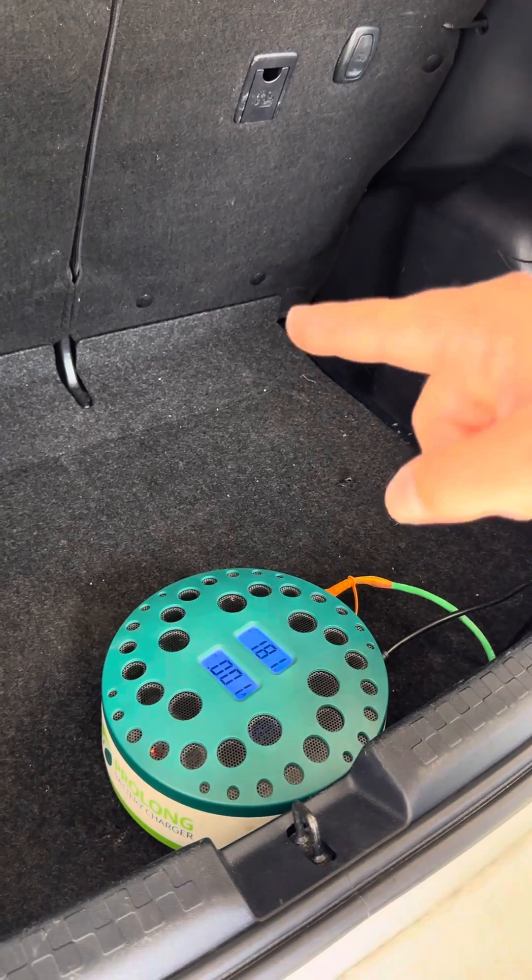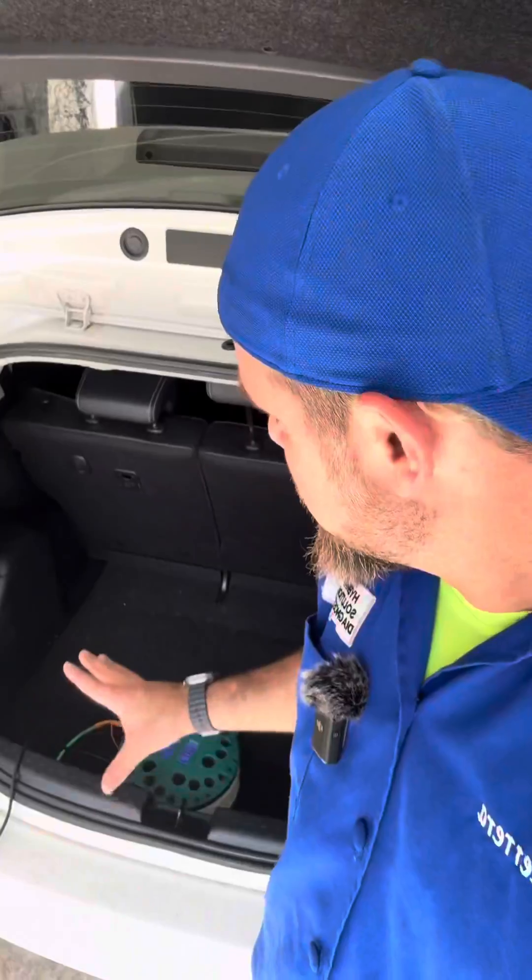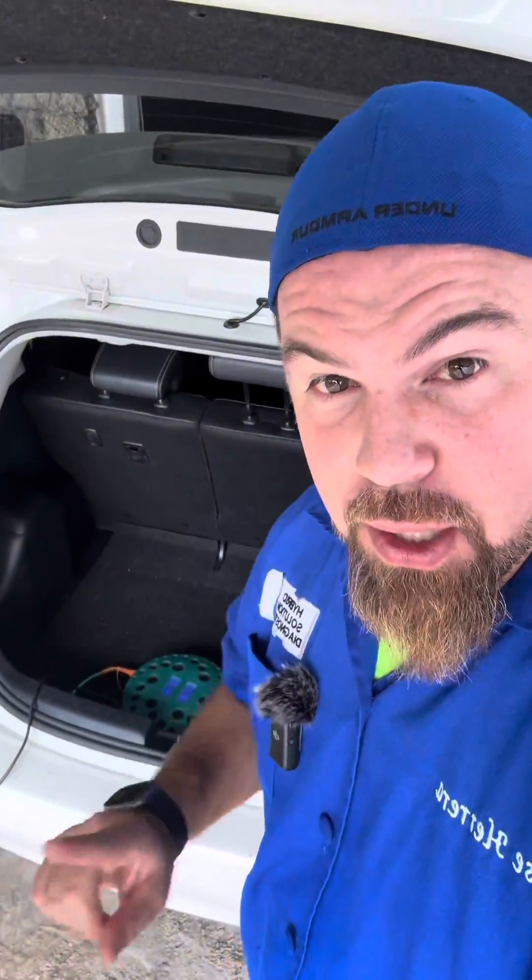We are now injecting 180 volts at a low current rate. But what is the main purpose to turn your car into a plug-in hybrid if it's a regular hybrid? The reason is to force rebalance your battery, because it cannot be done via the battery management system. We're just using a low current special grid charger to force rebalance — just connect your vehicle to the grid charger for at least 16 to 24 hours and you will always be reconditioning it in order to use its maximum capacity, because the battery will always be in balance.